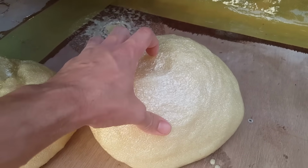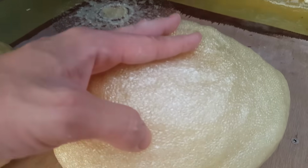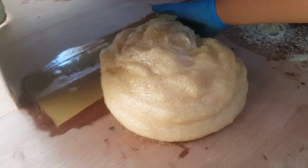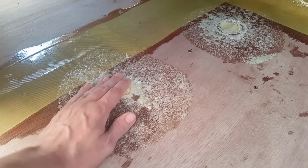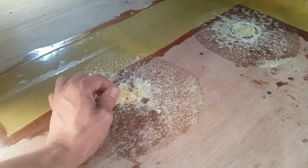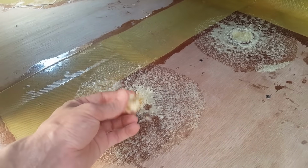This is a lot different than that spray foam that you'll get from Walmart. And like I said, this is closed cell. It is specifically designed to resist being in contact with water. All right, so let's go ahead and remove the last one. It comes off pretty easily, and we'll go through afterwards and sand this area. The instructions say you need to wait about 30 minutes, but this is actually still a little warm.